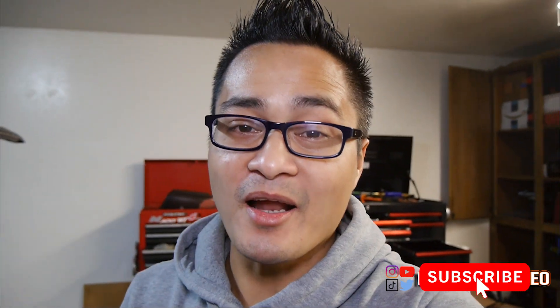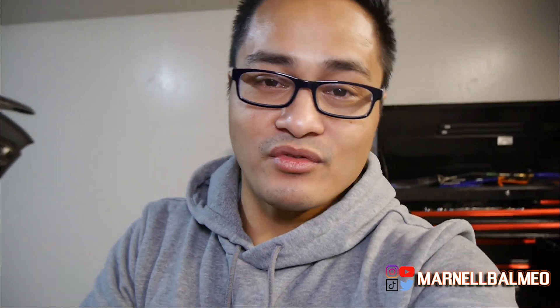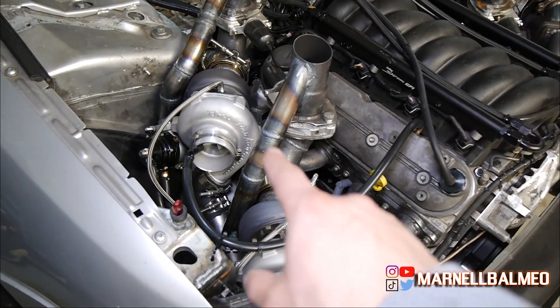The car pulled a lot better compared to how it was running previously, so I definitely think the new system is a much better setup. As an added bonus, the turbo wasn't smoking on the drive home like it normally does. My guess is that with the crankcase pressure I was building under boost, it was jamming up the oil drain on the turbo and not letting it fully drain out. I still have about one psi during boost, so I need to figure that one out.